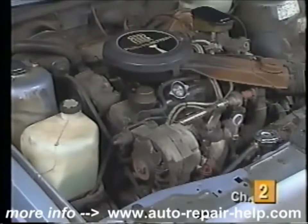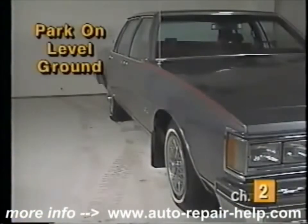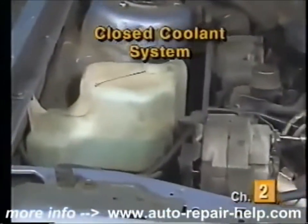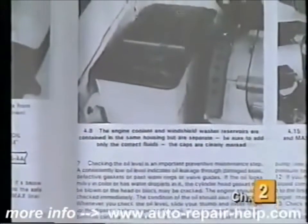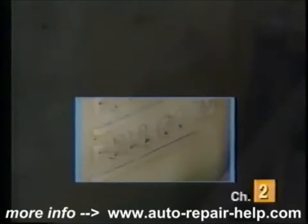Inspecting your vehicle's engine coolant fluid level will help protect your vehicle's engine and prevent costly engine damage. When checking fluid levels, make sure you park the vehicle on a level surface. First determine if you have a closed or non-closed system. A closed system will have a coolant recovery bottle located on the fender; a non-closed system will not. Non-closed systems are primarily found on older vehicles. On closed systems, the recovery bottle will have one or two level marks — the lower mark indicates where coolant should be when the engine is cold, the upper mark when the engine is fully warmed up.